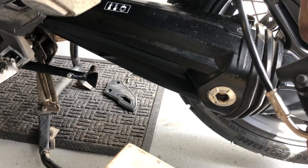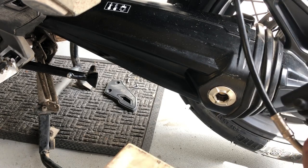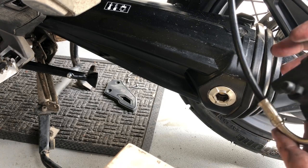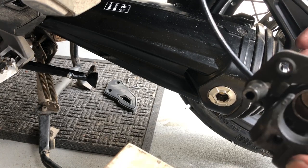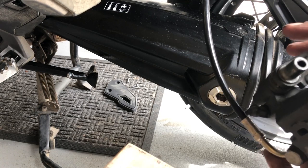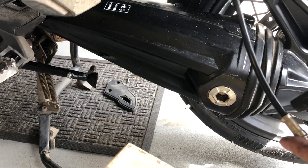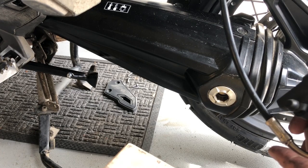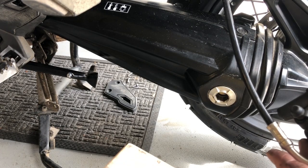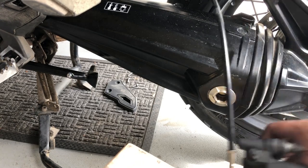I've put a tiny bit of grease in these pins in the guide, so you really want to be as frugal as possible with the grease and copper slip or anything like that anywhere near brakes — you see some people lather it on, but the minimum you can get away with is all you need. So now I've got this back clean, my pistons moving nicely, and when I push my pistons back in my brake reservoir is at the top level, so I'm probably not even going to have to top that reservoir up when I put the new pads in. Let's go and wash my hands.